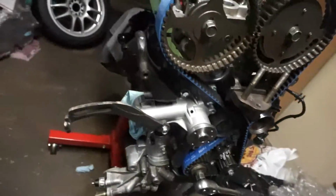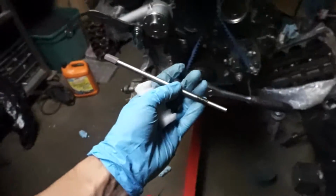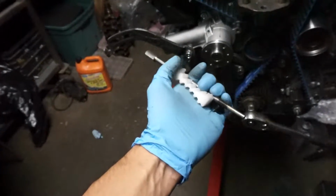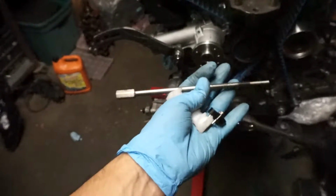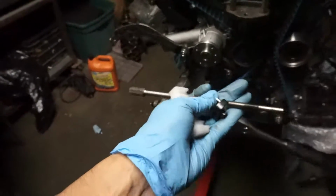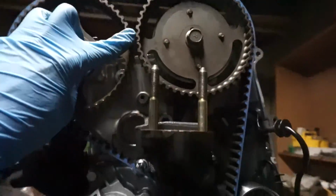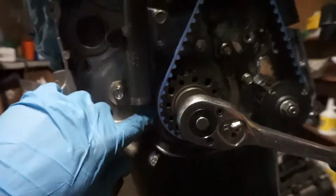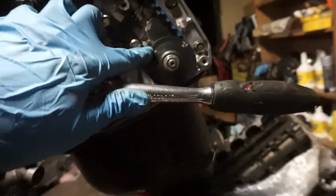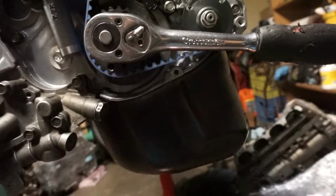So after using the Extreme PSI kit, I can't emphasize enough how easy timing is with these three. So this helps line up your cams. This puts the tension so you can torque down the tensioner pulley. So you got top dead center, and you got the plate lined up to there, and this line lined up to the imaginary balance shaft.